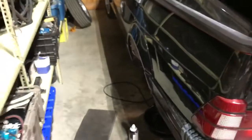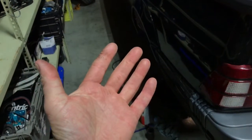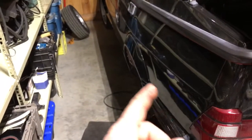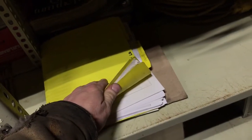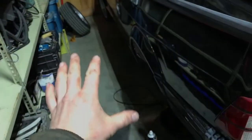And I'm like, holy crap, there's like an inch of play there. I just rebuilt everything on this car. Well, those rear wheel bearings were the one thing I neglected to do, because I had a receipt from the previous owner from Rally Round — I think in Tacoma or somewhere in Washington — that they were done in 2013. Given that they last like 200,000 kilometers, it would have been a waste of money to do them. But that bearing was absolutely destroyed.